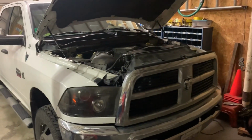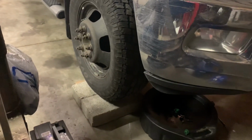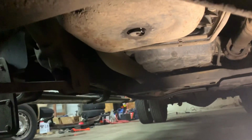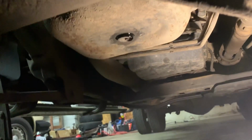Alright, getting ready to do the oil change. I like to just get underneath the car with my creeper and have enough room, so what I did is drive it up on these concrete blocks. I just put it in 4-wheel drive, and I put some concrete blocks on each side, as you can see here. Just drive it on there, and then it's pretty easy, works real well. Gives me just enough clearance to get underneath here. Although if you don't have those, you can do it without. You can get underneath here without, if you have a 4-wheel drive at least.